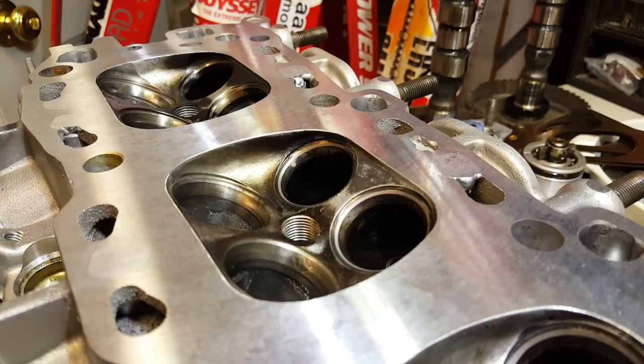I'm probably going to stick this one back in and do a little bit more off camera. But needless to say, that's all there really is to it, guys — very easy to do. Valve grinding compound, go back and forth a few times, just lap the valves, get them to where you're not going to have any leak. You can pick up quite a bit of horsepower — a lot of people end up losing 40 to 50 horses just from a little bit of leak-down. Any time you pull the heads out, do this. Never hurts, it's cheap, very inexpensive to do, and it adds horsepower.